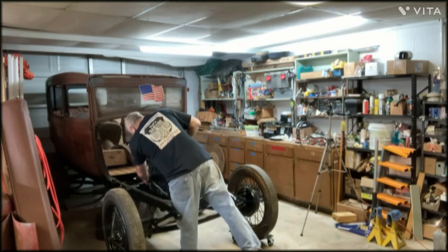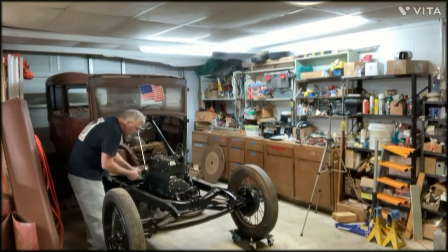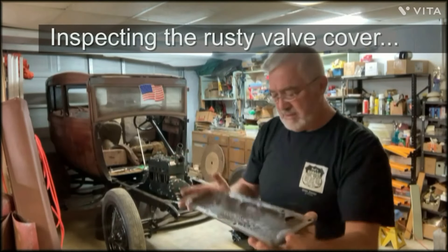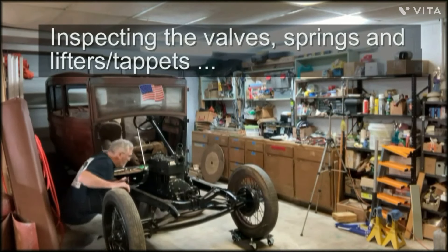I could take the side cover off here and see what it looks like inside. See, it's a little bit rusty on the inside there, which should be coated in oil. I can show you the valve chamber. In there you can see the rust, and you can also see the ports — the ports are actually looking really clean. And I can see the valves right in there; they actually look really nice. But this valve chamber is just horrible.